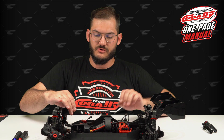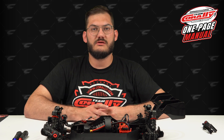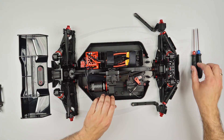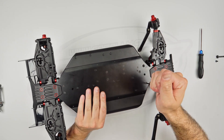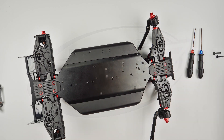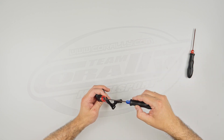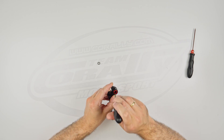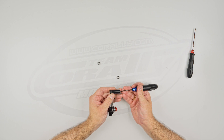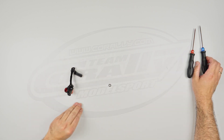Now it's in your hands. There are also those two posts — during maintenance I usually do not move them, and they are only secured by the two M4 screws underneath. To complete step number two, you need to remove the bearings from here; you don't want to leave them like that. Basically, you want to just put the screw inside and tap it from here. You don't have to use plenty of force — just take them out, moving one side to another in the plastic, and they will just come off.